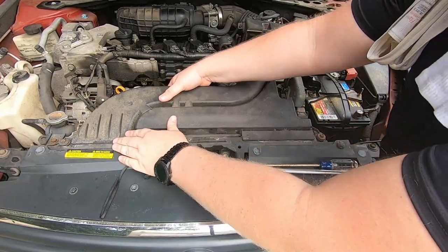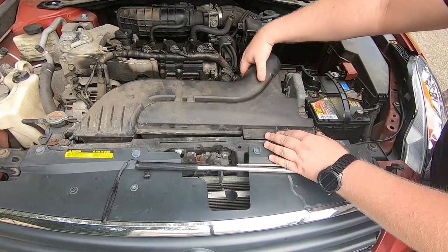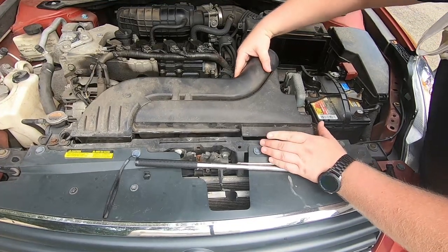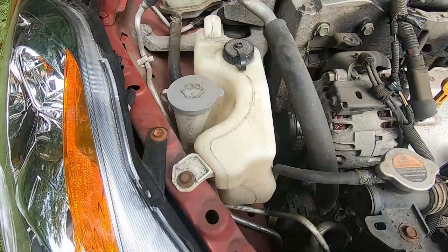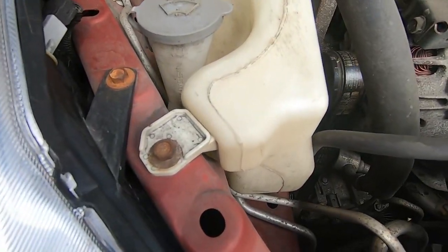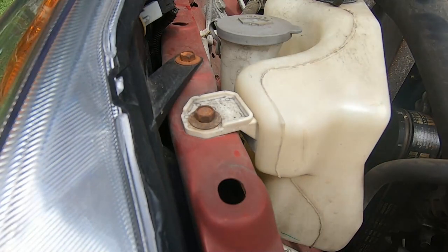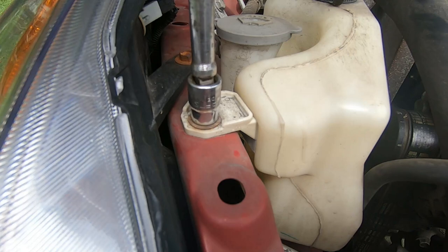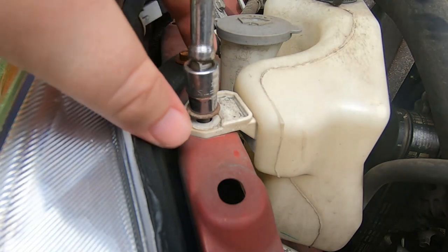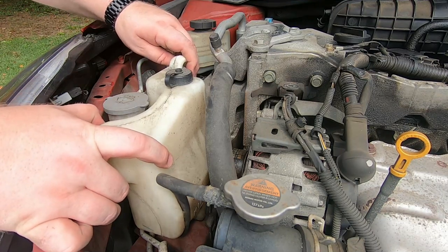You can see the opening on each side — it kind of allows you to snap it into place so you really don't have to unscrew it. One of my screws came off. This part is just showing everything you have to loosen. This is for the coolant reservoir — this is that 10 millimeter bolt and then that should pop off.